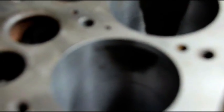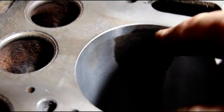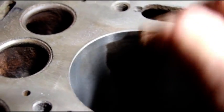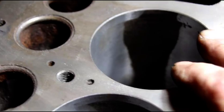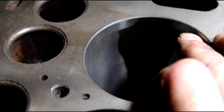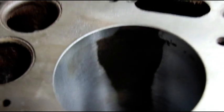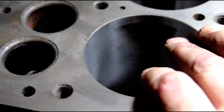I'm not going to be able to clean this up. I thought I'd clean it up in 10 thousandths, but when I measured crossways — you normally don't get anywhere in that direction — I didn't clean up in 10. I thought I might clean up in 20. What you're looking at now is a 30 over bore and I still have more than halfway down — a big problem.